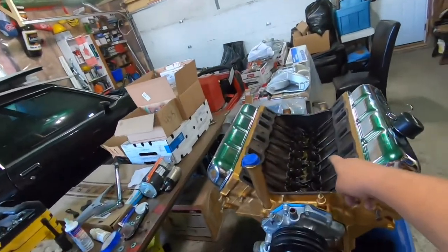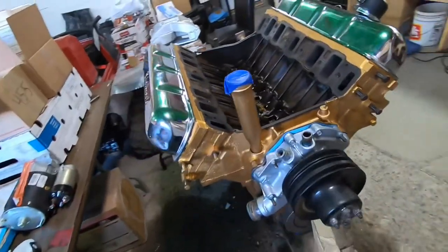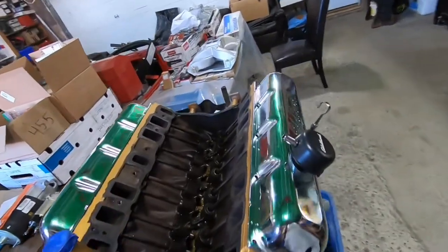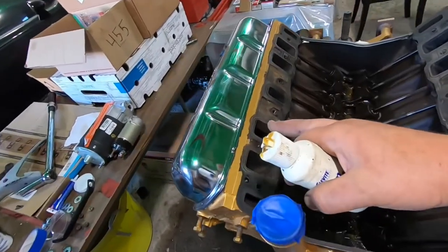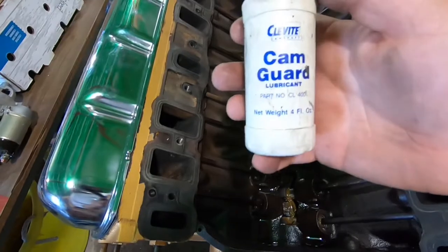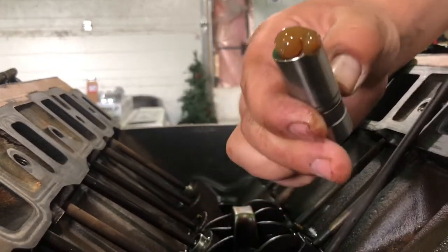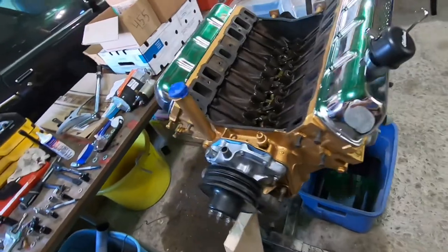We got no problem - go ahead and slam our breather tubes on and the intake manifold. I swapped out that water pump for the one off the 307 and one of those gaskets out of the kit worked just dandy - no problems there at all. Before putting the new rocker arm bolts in, I pulled each pushrod back out and popped the lifters up and gave a fat dab of cam guard that my father-in-law had suggested. I also greased a whole bunch of it onto the camshaft, so when we break this sucker in there should be no issues at all.